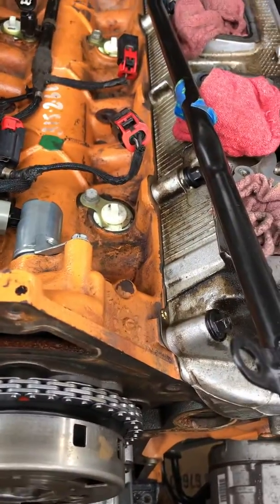While I'm here, I'm going to show you this — I don't know if you'll be able to see it with the orange paint, but that's the mark you're looking for on the top part of the phaser. These two need to line up with it. The reason it doesn't line up now is because we spent 20 minutes straight yesterday hand cranking the motor over, checking all of the rocker arms and making sure everything is doing its thing.